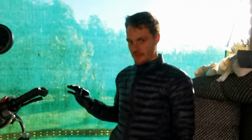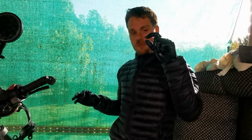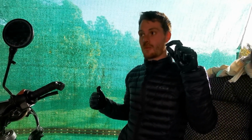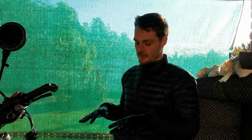What you're going to do then is take your shims, and if you don't know the size that they are, if you haven't kept track or you bought the bike and you have absolutely no idea, you're going to need to get a micrometer and measure the height of your shim. And from there you're going to need to do your calculations of what size shim you need to get within spec. Go buy that size, install them, and it just goes back. It's very, very straightforward after that.